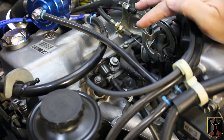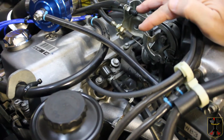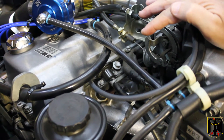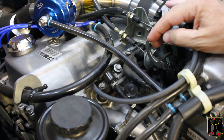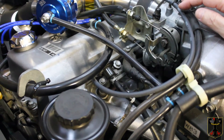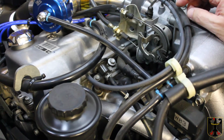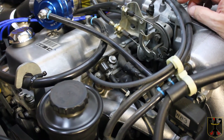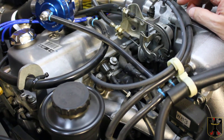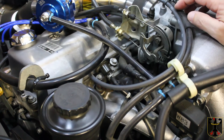The reason we're doing this is we think we might have a fuel pump issue, so in order to do some diagnostics we want to have a fuel pressure gauge so we can figure out if it's the fuel pressure regulator, the fuel pump itself, or possibly an inline fuel filter. We replaced that only about 10,000 miles ago, so we're not sure yet where to look. We're going to divide and conquer — get this apart, put the new assembly on, and we'll be right back.